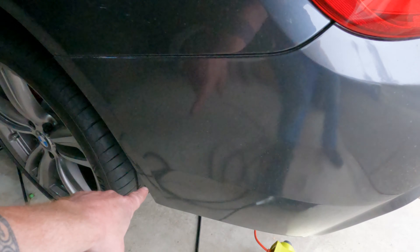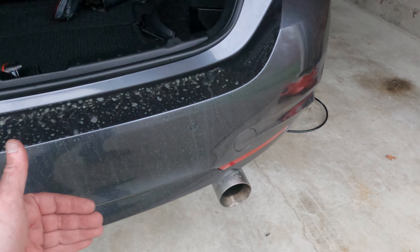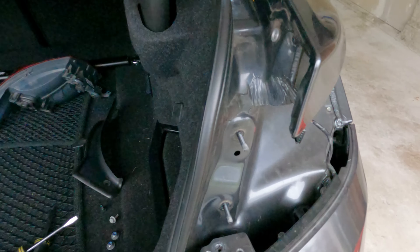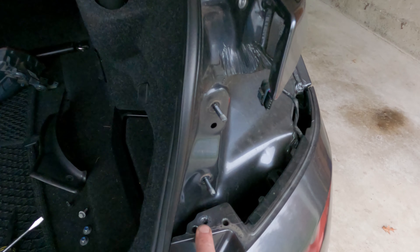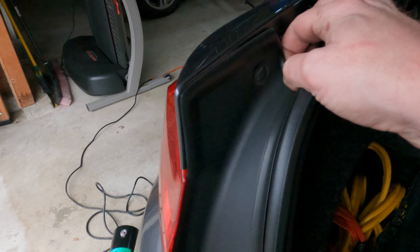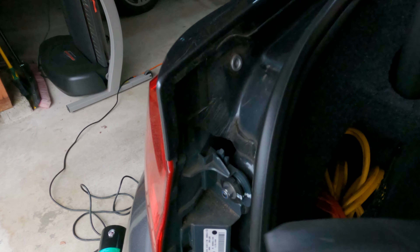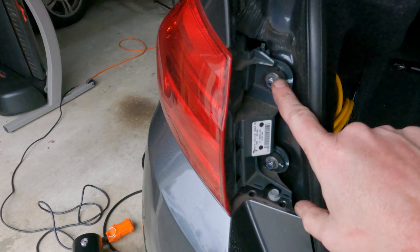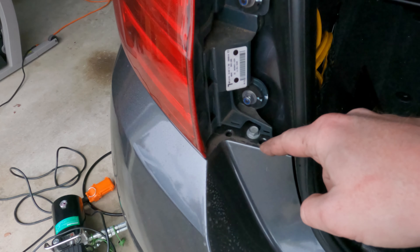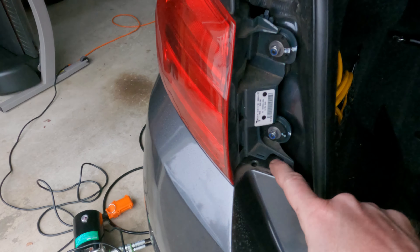I've got the three longer eight millimeters alongside, three along the bottom which are shorter, and the three 10 millimeters across the middle which secure where that sensor array sits, then the same across the other side. The other thing we're going to want to do is take your taillight out, because your taillight is in the way of one of the screws that holds this in place. Take your rain track off — there's a 10 millimeter bolt right here that needs to come out. You've got a little plastic rivet that you can turn with a flat screwdriver, and then your rain track will come out. Your rain track will pull up and away just like that. Now you can see your taillight — you've got two nuts that hold it in place, two 10 millimeter here and here, and then a 10 millimeter holding the top part of your bumper cover on. Gently pull your taillight out and unplug — there's a little pressure clip on the plug, so just pull that out, take it out and set it aside. Then you can pull this 10 millimeter.